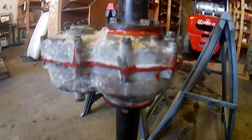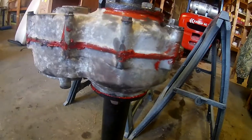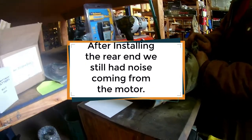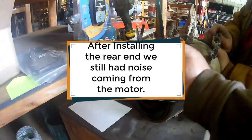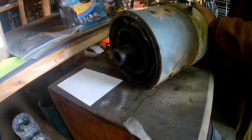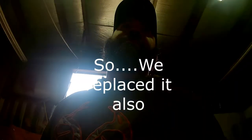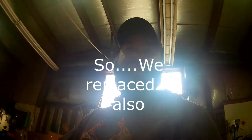They got really lucky that it didn't tear up any gears or anything. We're going to be putting that back in later today. Once we replaced all the bearing stuff in the rear end, we still had a noise, and we found it's the motor — it still operates but it's super noisy. Hopefully this helps you understand that you might have a noise that comes from inside the motor. We appreciate all you subscribers — keep hitting that subscribe button. We're going to try to put out more videos as often as we can. Thanks everybody, have a great day.